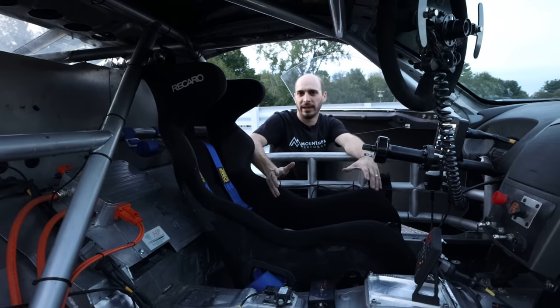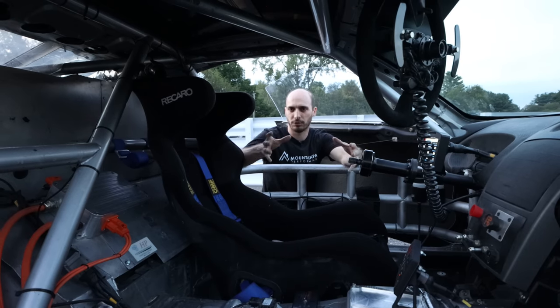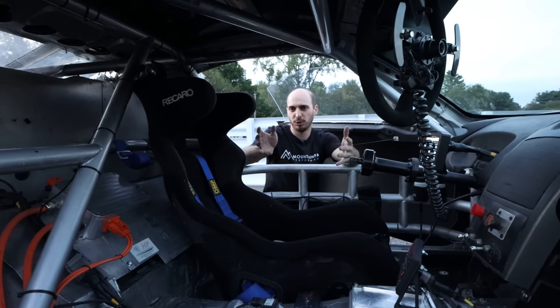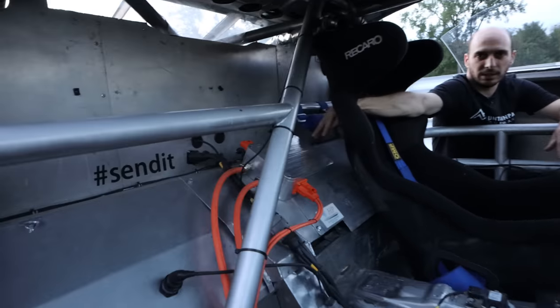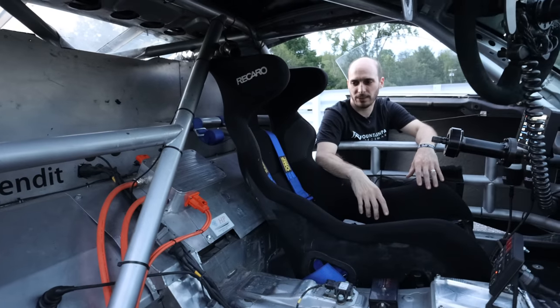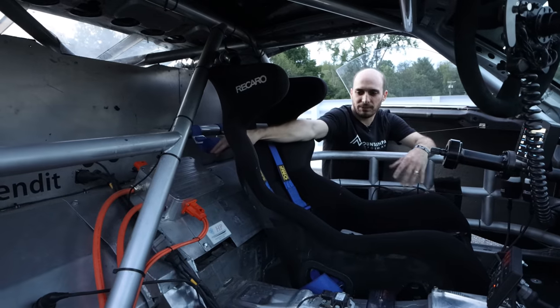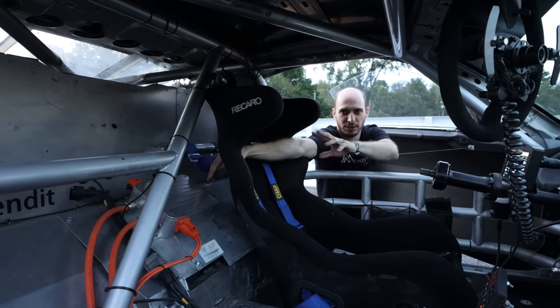It's actually a BMW i8 hybrid off-the-shelf battery that we've taken apart and reconstructed to fit as a cube under here. Those cables come up into this power distribution box, which is the main big switch. With Vaughn Gittin's car, I'm sure you've seen how that works. If the system detects a fault, you turn the car off, and there are switches in here so the high voltage doesn't go to all the other components.